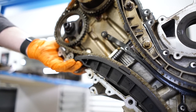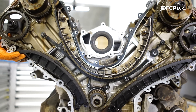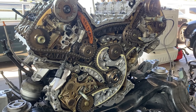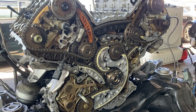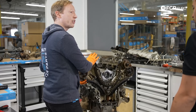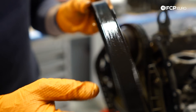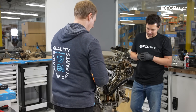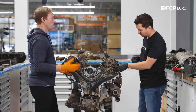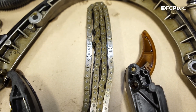If you've ever cracked open an Audi V8, this is like the opposite of it — this is super simple, nice, big, giant adjusters, and there's three guides. For Audi, they've got a dual overhead cam V8, almost identical displacement, with four different timing chains and who knows how many guides and tensioners. This has one chain and one tensioner that you can easily replace from outside the engine. This is one of the reasons why Porsche, when they actually put their engineering effort into something, can make something that performs extremely well and is remarkably trouble-free. 138,000 miles, unknown service history, and there's virtually zero wear.